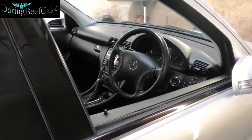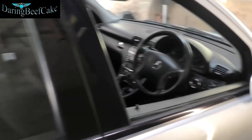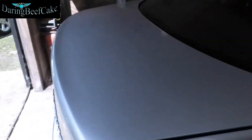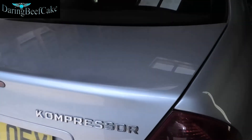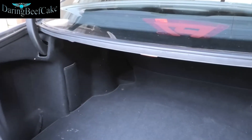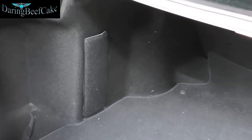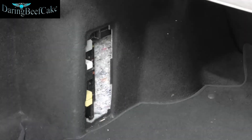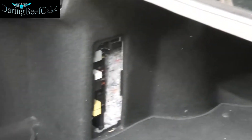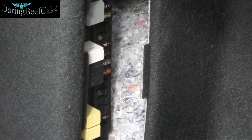Almost like if you didn't have an aerial, basically. So a very common issue with those two is that the fuse at the back is blown. So if you just open the boot and find the fuse box - the fuse box is just behind that panel there. And fuse number eight inside there is the one in charge of the signal for the radio and for the remote.